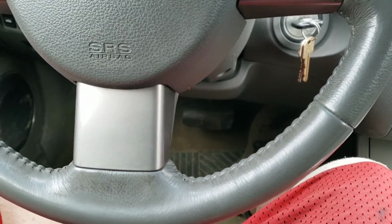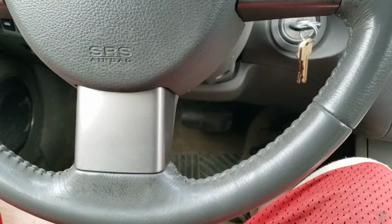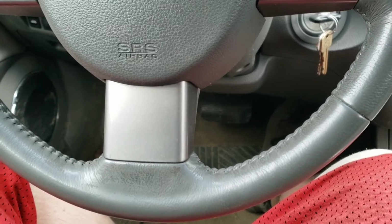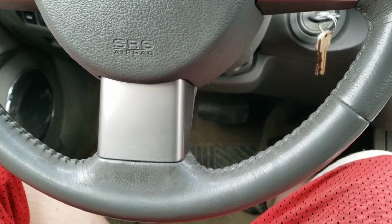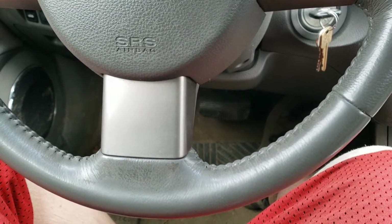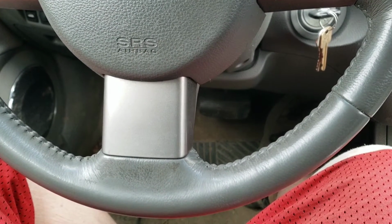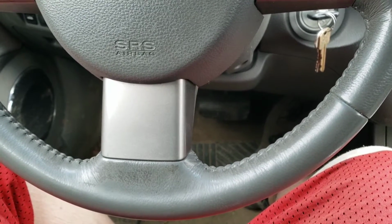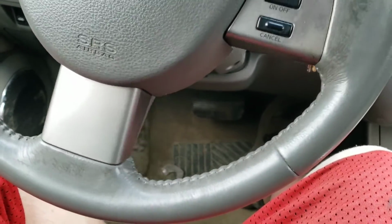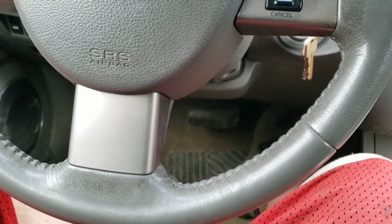You want to be careful doing this. Some cars, if you take off and drive right now and you go to hit the pedal, it's going to go almost to the floor because it's got to make up all that space. And if you allow that to happen, some cars have sensors and valves in the braking system that will think you blew a brake line, and then it'll divert pressure from either the front or rear, depending on which one it's reading that did that. And it'll basically lock out either the front or rear set of brakes. I've had it happen before. And then typically it's a real pain in the butt to get it to reset, or you have to take it in and have them reset it with a pressurized system.